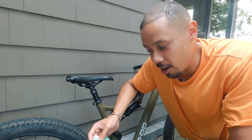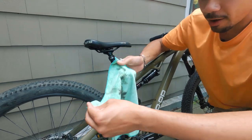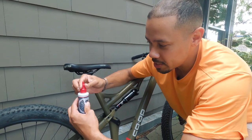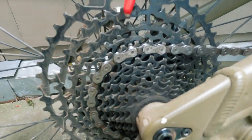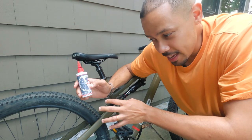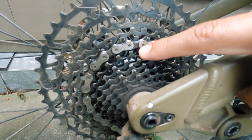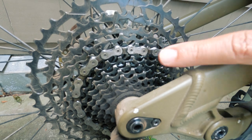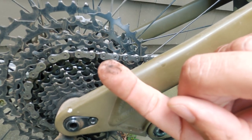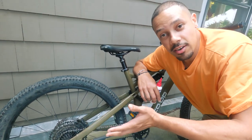That's the way I like to lube my chain — very little waste, you do exactly what you need and no more. The way you'll see a lot of people do it is they open up their chain lube, spin the chain backwards, and just spray it all over the chain. In theory you're getting everything you need, but you're also spraying a ton of chain lube all over the cassette and into a bunch of spots that didn't need it. Now all of that is just potential to collect dirt. You can see how several cogs are now all wet — all of that just grabs more dirt. You're trying to minimize the amount of dirt that gets into the drivetrain, because less dirt means a better drivetrain.